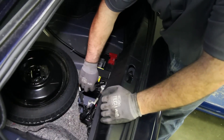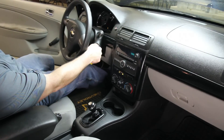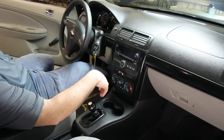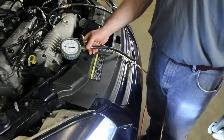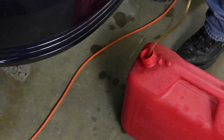With the repair complete, reattach the negative battery cable. Cycle the key two to three times in order to charge the system. Start the vehicle and monitor fuel pressure, making sure it's within vehicle specification. Before removing our pressure gauge, shut the vehicle off and bleed the pressure using the gauge, making sure to capture any fuel into a safe container.